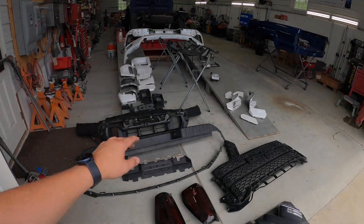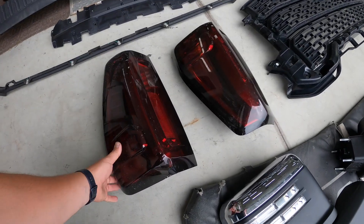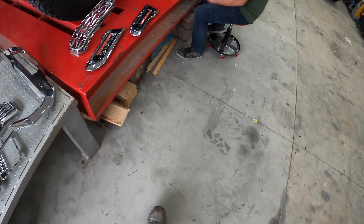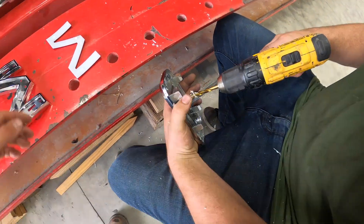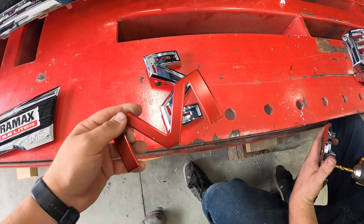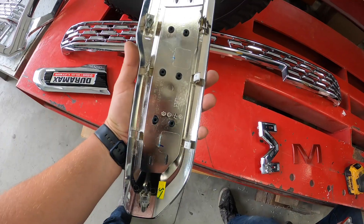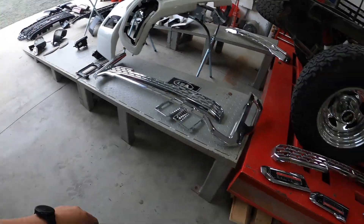It's quite a big job. We still have to get the mirrors apart, still have to get the tint taken off the tail lights — you can see the vinyl is kind of peeling up. Cory is working on getting the emblems apart by drilling them out to break the factory plastic welds. We have to do this in order to paint because there's no way to mask all that up. He still has to do the side badges the same way, and then we're also going to get the mirrors apart.